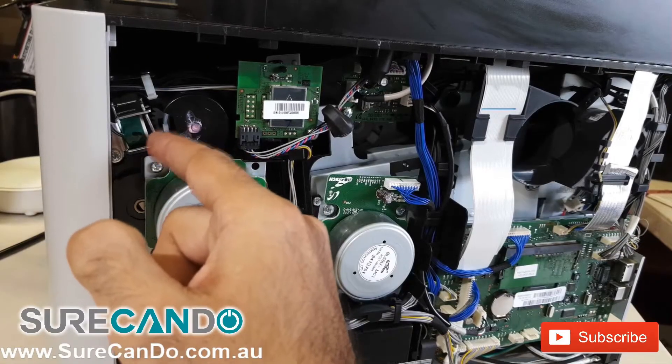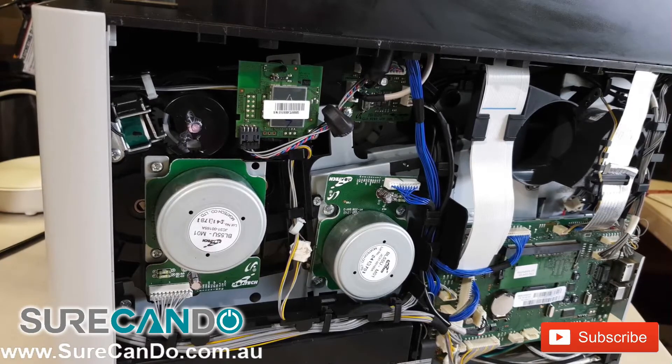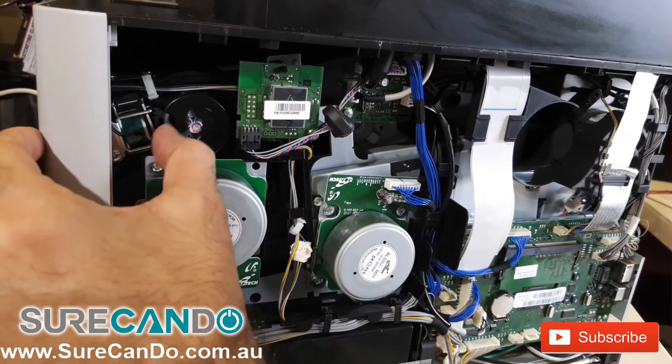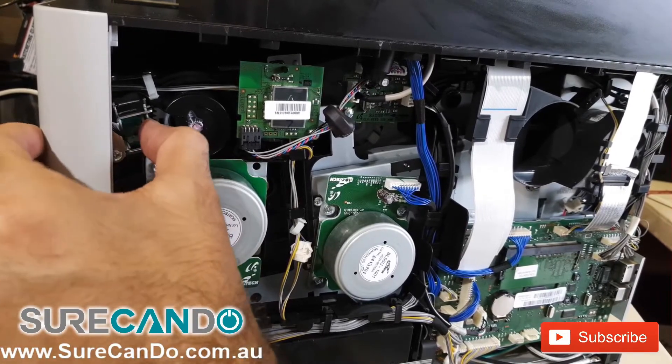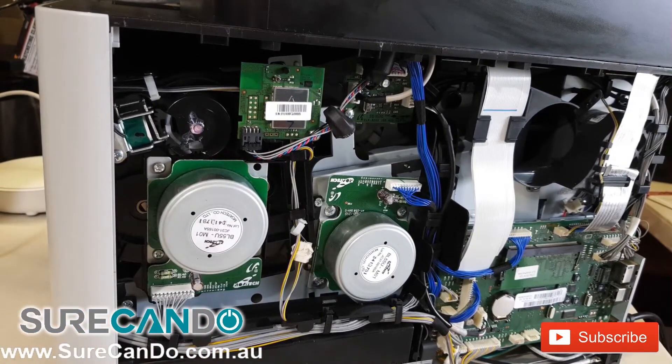This little part here on the left — a magnetic component — is where the issue is. The gap there is too big. There is a little padding inside which keeps it away from the magnet to a certain degree, and this little pad wears out over time. You'll need to remove that pad and put something of similar size, or add another sticky tape or cushion on top of the existing one. As you can see, it's releasing and locking when it needs to, and sometimes it cannot lock — that's why you get the error message.